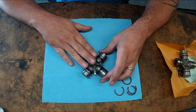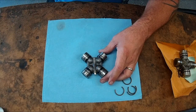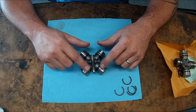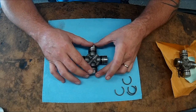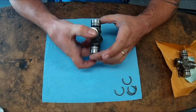So what we've got here is one of the universal joints for our 66 Mustang project. This is our front universal joint — it's your standard light duty. You can get joints in 1310, 1330. 1350 is a one-ton size universal joint. 1410s are a little bit beefier than a 1350, 1510s, and it just keeps going up the scale. The most common sizes we use in the automotive world are 1310s and 1350s in situations where you're putting down a lot of horsepower. They have four caps here. Two of the ears sit into our slip yoke that goes into the transmission and the other two go into the drive shaft, allowing the yoke on the front of the drive shaft to pivot up and down as it rotates.